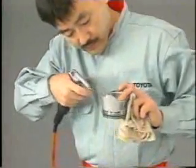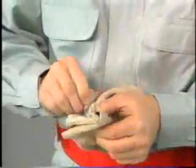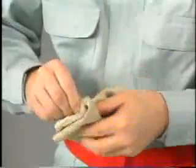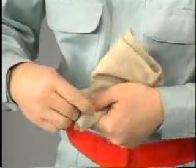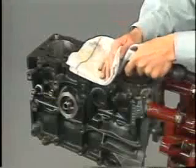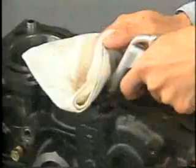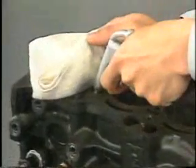After the disassembled parts have been inspected and corrected, they are to be reassembled into an engine unit. In reassembly, check each part carefully for foreign matter. Clean the rear side of each bearing to remove dust and grease. Using compressed air, remove foreign matter from each oil hole and bolt hole of the cylinder block.